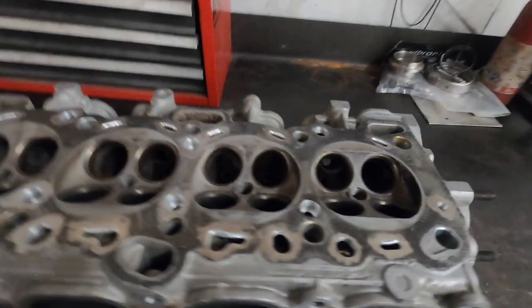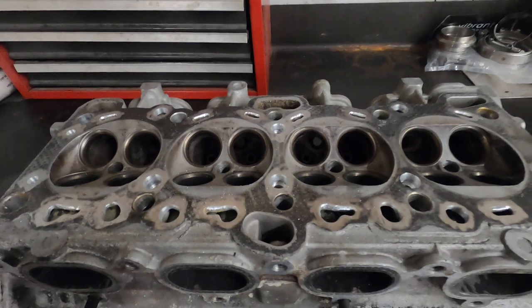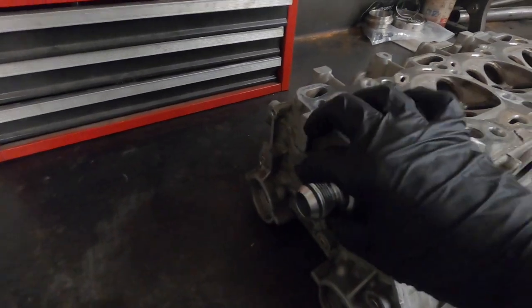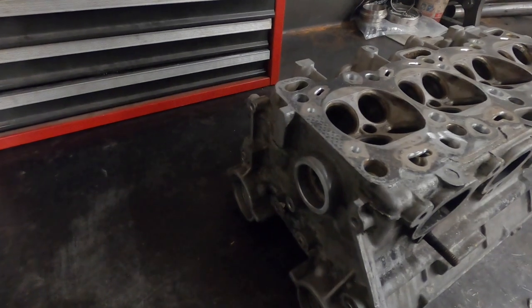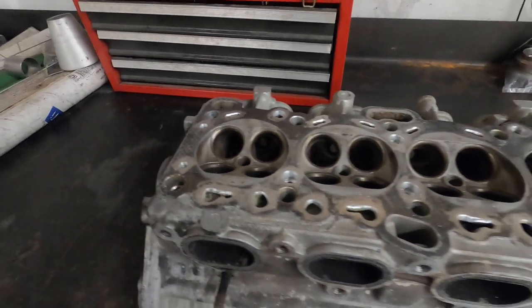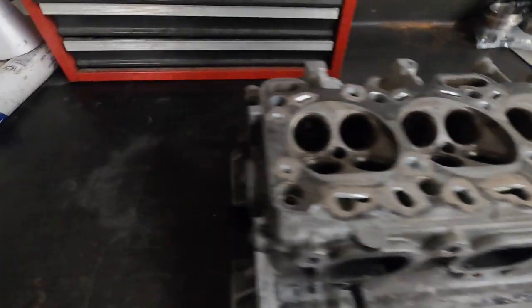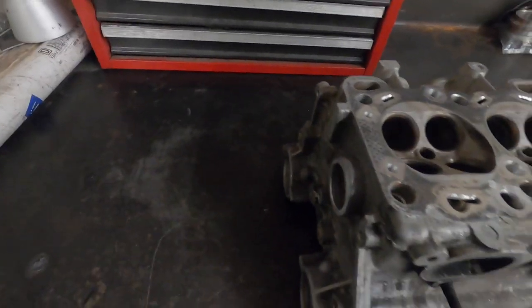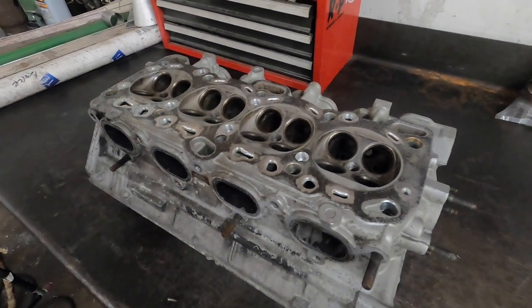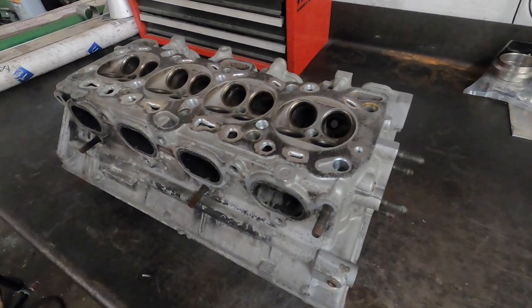The other thing we do with these, obviously there's no water running through between the block and the cylinder head and the head gasket anymore. So we will put a dash 16 fitting where there used to be a soft plug on the front side of the cylinder head, and then you can run water through the head through the normal thermostat housing on one side, and then where that soft plug is on the back, that allows us to still run coolant through the cylinder head. The block for this has already been filled with hard block.